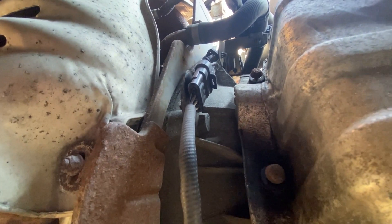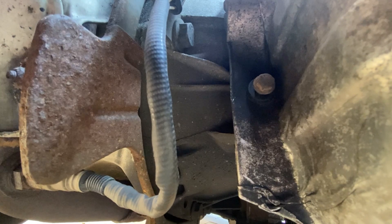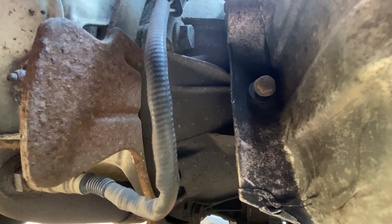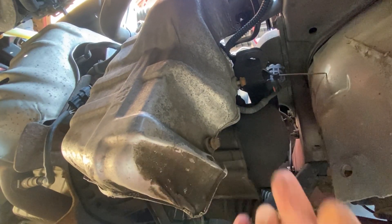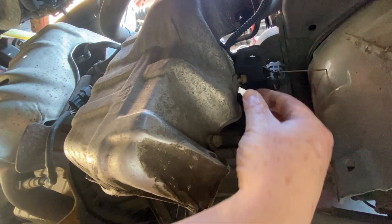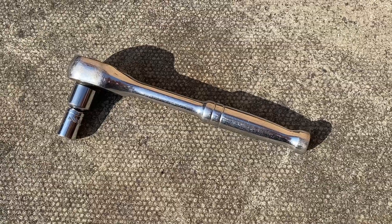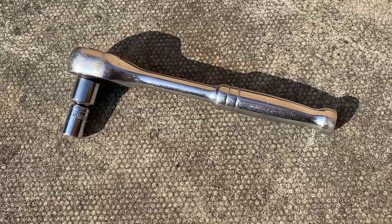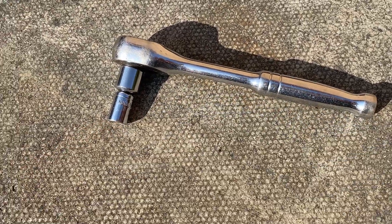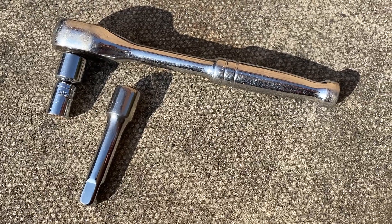You can see I've loosely put the bolts in - there's one at the top and the other one there, which was the more corroded one on that side of the shroud. There's a bolt there I'm going to tighten up, and one up there as well. I'm using a little ratchet tool with a 10 millimeter socket - for one side you don't need the extension piece, but on the other side you will need the little extension bar.